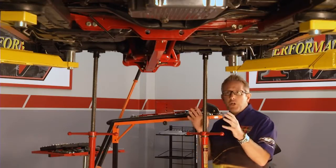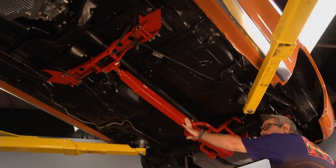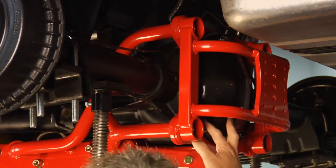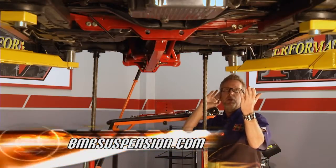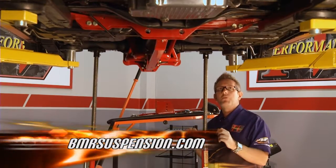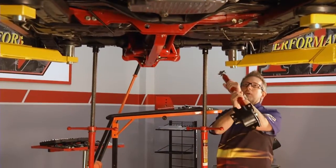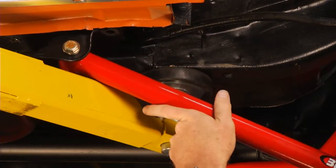It's a big job. We've already got the torque arm front mount put in place, the torque arm mounted in the back. You have to take the cover off the rear end — it bolts directly to the housing — then put the cover back on. Now we've got to remove the factory leaf springs, which we already did. We removed the hanger, and now it's time to put the lower control arm on and attach it to the rear end housing. All this stuff is bolt-on directly — no fabricating, no welding, no cutting.